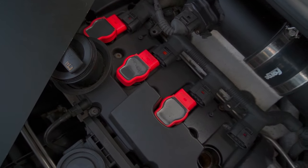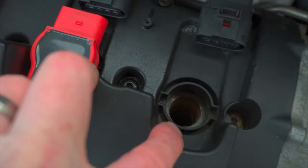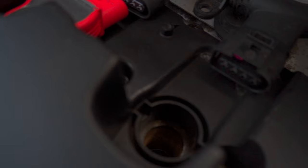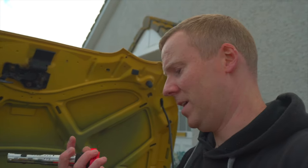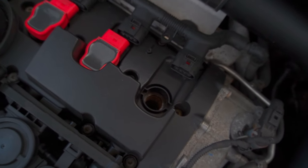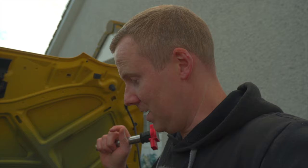If it has got water in there or debris, blow it out with compressed air and make sure it's as clean as possible. You want as little debris inside that chamber as possible, because once the spark plug comes out it's most likely going to fall straight into the cylinder. Going unrectified, this can kill off the coil pack quite quickly, causing misfires when revving harder. So the quicker these holes are sealed up properly, the sooner you'll have peace of mind that the engine won't have any issues.